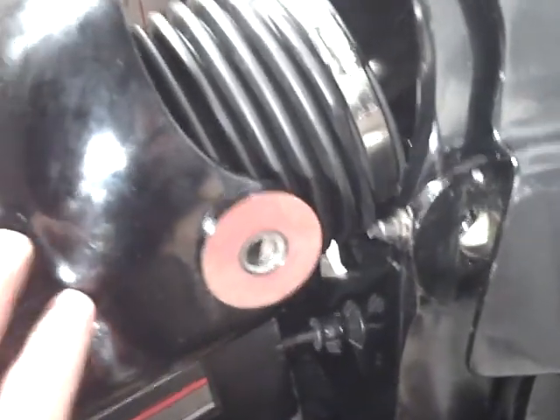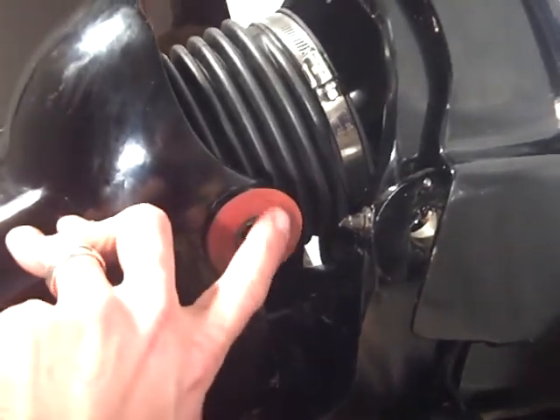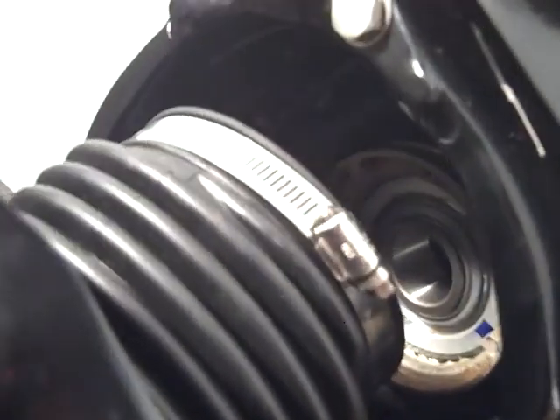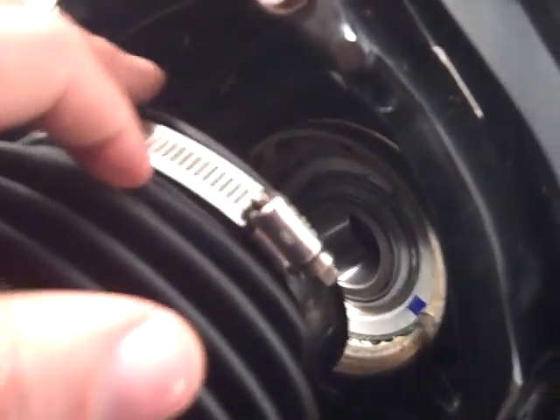At this point I am ready to put these two halves together. I'll throw a little grease on these fiber washers and put some bellows adhesive on the transom side for the u-joint bellows, and I'll see if I can get these two halves together. But first I need to go for a run because I'm kind of flabby.